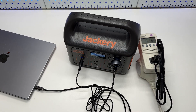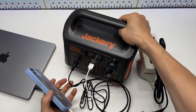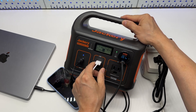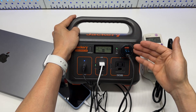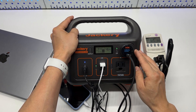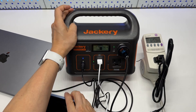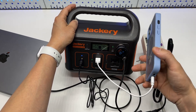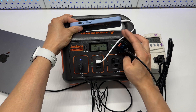I'll also be able to charge my phone slowly. These USB-A ports are only rated at 5 volts, 2.4 amps — a shared 12-watt USB charger. So I would recommend if you want to charge faster, get a larger car charging adapter and you may be able to get around 120 watts out of the 12-volt port, which is usually rated at 120. It's suitable for charging laptops or phones. For the old USB Type-A ports, they're designed for GoPros, phones, and tablets if you're not in a hurry — otherwise I would totally get a car charging adapter.